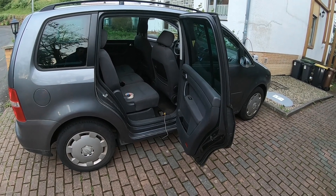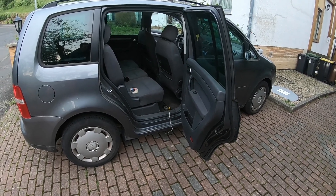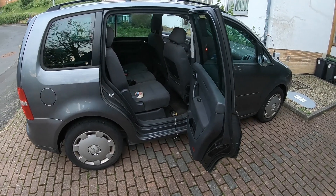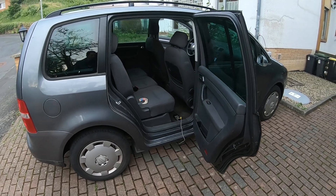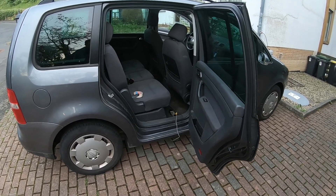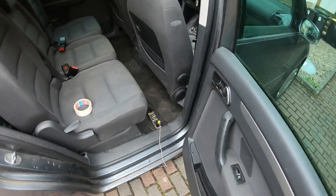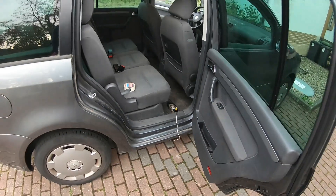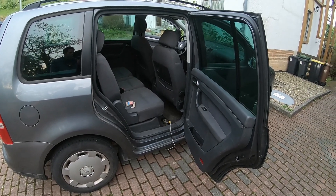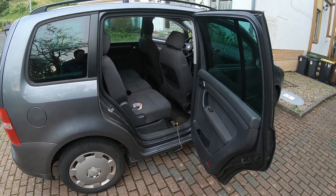Lastly, I fitted a fan to the battery box that blows air in the middle and it exits to the right and left. Today we will test how effective all that is. We'll drive to a rapid charger here in Kassel — the battery is pretty empty so it can take lots of amps. I've glued a temperature probe to the cable in question, attached to my multimeter. Currently we've got 18 degrees ambient and we will see how the cable heats up during a quick charge session, and also look at how battery temperature develops.